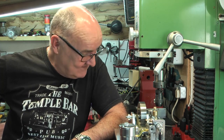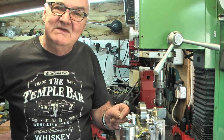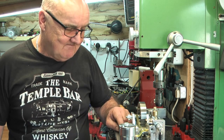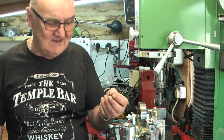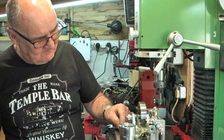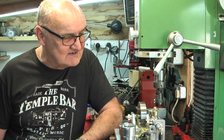I had to play with the timing a little bit. I found it was flooding a lot — I had to screw the mixture screw on the carb right in. I've actually replaced the main jet with one with a much smaller hole. The original was a number 65 drill and I've gone for one with a number 75 drill, which allows me to open up the mixture screw a little bit.